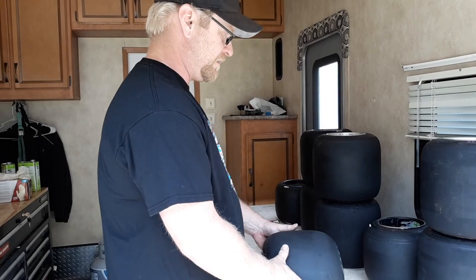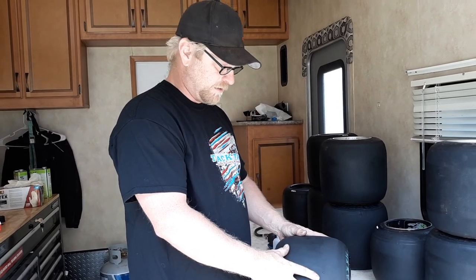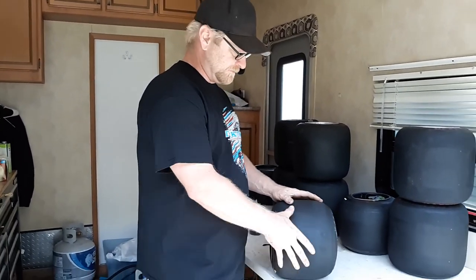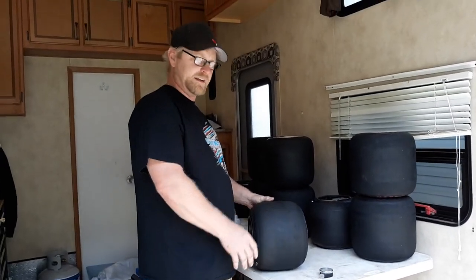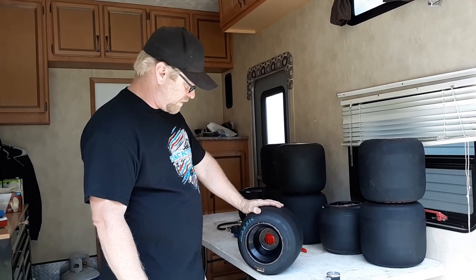Instead of adding a lot of air to stretch a tire and letting it sit, you can take air out of it. We've even gone as far as buying ice, putting it in a cooler with water, and dipping the tire in there to really suck it together and shrink it down to where we want it. A lot of times that's done at the racetrack to get it done quick.